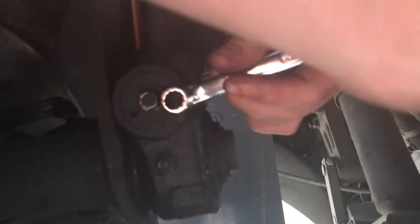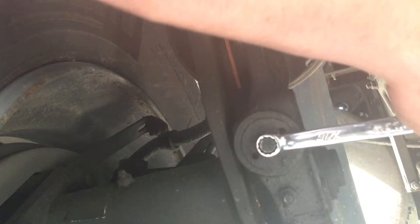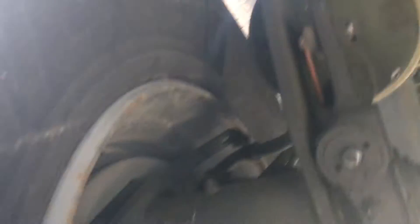Come back and do the same thing on this side. When you're doing these, there's the little inspection shield — that's where you'd be looking at the pads touching inside the drum. Touch. Again, half turn back. And now we've got to tighten these nuts. Move on to the other side.